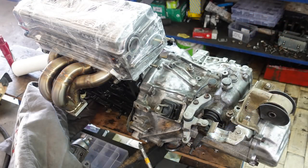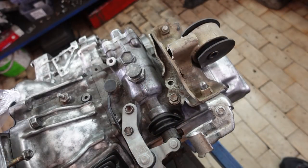The next stage is going to be engine mounts. I expected — without doing any research, I'm really ashamed — that the transmission mounts for the stock AW11 naturally aspirated C50/C52 transmission would just be the same as on the E51 supercharged MR2 Mark 1 transmission. They're not. We're going to have to modify all three of the transmission mounts. We already finished one — the driver's side on a left-hand drive car is already done. We're going to have to do the front and rear one, which don't seem too difficult. Overall, the supercharged MR2 Mark 1 seems to have the whole engine a bit higher in the engine bay for some reason, and the mounts on the transmission itself are kind of different.